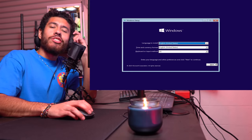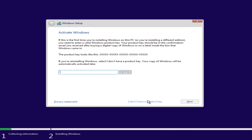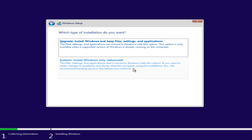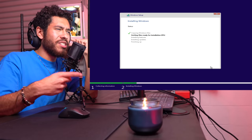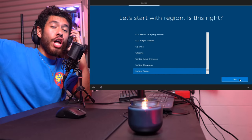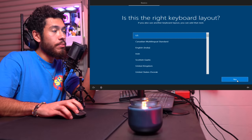Installing Windows 10 is just a matter of clicking next for the most part. If you have a product key insert it here - I'm going to select Windows 10 Pro. Click next, pick custom, then we're able to choose where we want Windows 10 to be installed - we're going to select our SSD. Let this do its thing, the computer's going to restart two or three times. Once we arrive at the desktop, Windows 10is now copied onto our SSD - you can unplug the flash drive now.